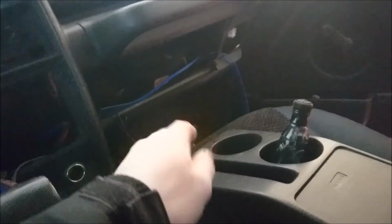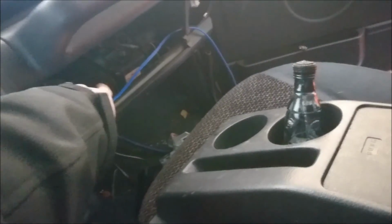And then it's just getting the power wire, which we already have in the vehicle, to go down. And I'm probably going to bring it down like this. I'll separate it from this one, so I'll zap strap it on the low side. And then instead of going through here, it'll be down there. And it'll come along this side, away from the RCAs here. But it'll come off this side and then through a different incision. Then we just have to ground it, and we're going to have some sound.